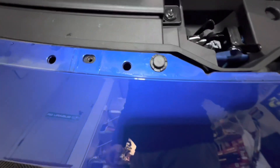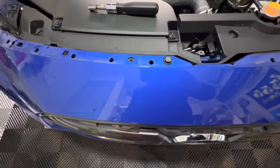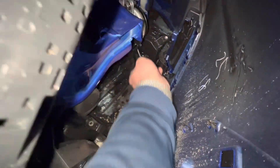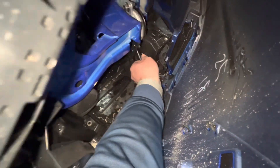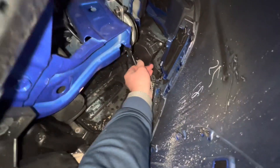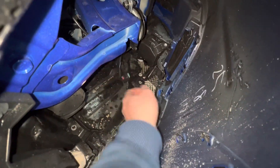We've just dropped one of the plastic pins in, working it loose so the bumper doesn't fall onto the floor. Also, the other thing you want to remember to do is undo the fog lights before you get ready to remove the bumper. So we'll just go ahead and pinch and squeeze and get that undone.